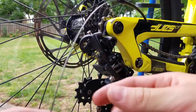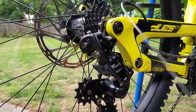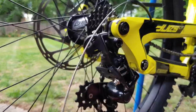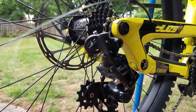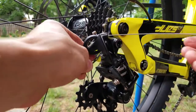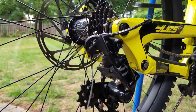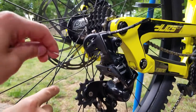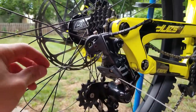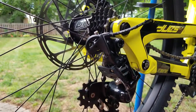With the cable through the other side of the housing, feed it into the derailleur. With a SRAM derailleur there's a cage lock — push it up and press the button and the cage is relieved of tension, making it easier to work on. Feed the cable around the pulley wheel, seat the outer housing, then feed the cable through the cam mechanism — there's a little hole and it's critical to the function of the derailleur.